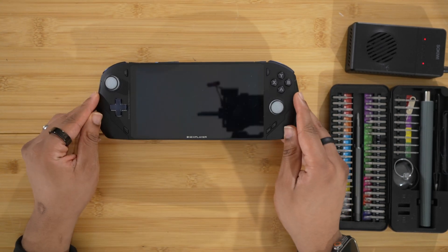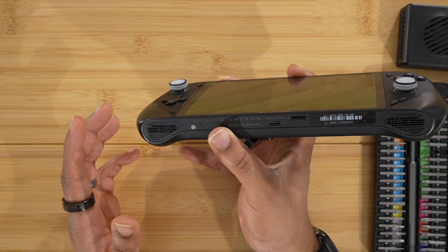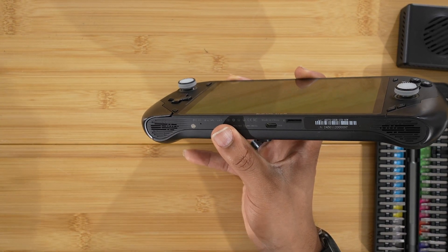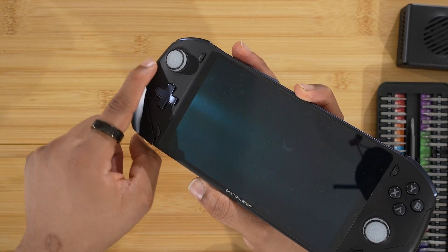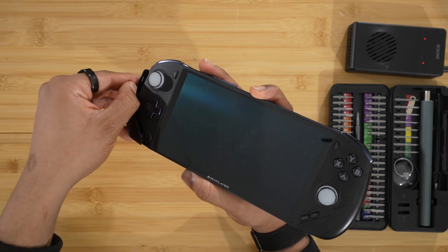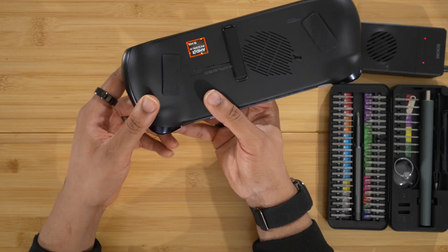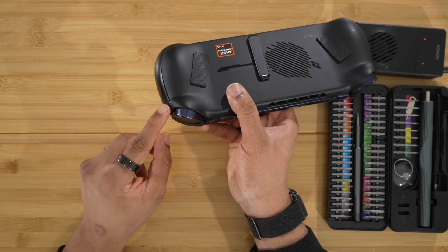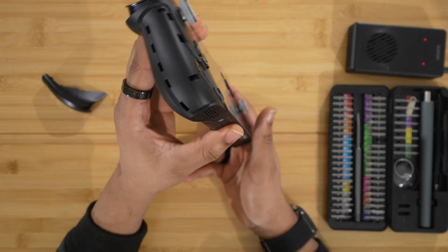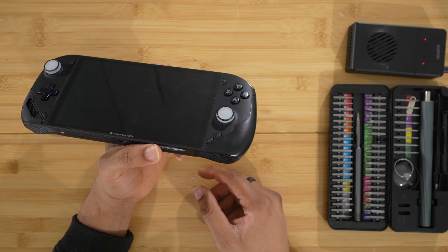First, you're going to take off these side covers. Get into the little crack here with a pry tool or your finger, and just pry it up. Don't take it all up in one go — follow this line around and pry up the clips on the inside. Once it's open like this, don't just pull it off because there are clips on the backside too. Follow this ridge along, release those clips, and now that side is off. You will see there are two screws revealed here.